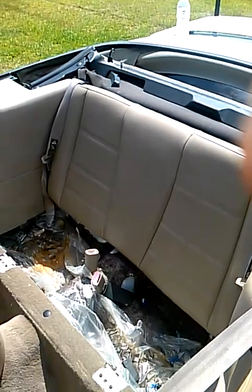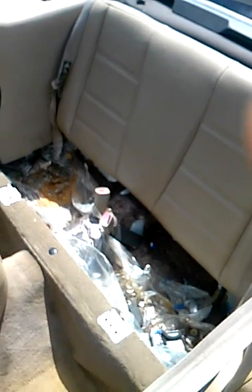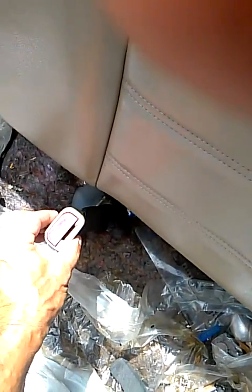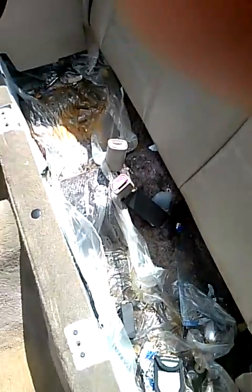Here we go. First, as you can tell I've already taken out and removed the back seat. It's very simply done — there's one clip here and another clip on the right side. The seat was down here; all I did was take the end of the seat belt harness and depressed right here on this clip. Once you depress this clip it pops right up. I took both those clips, depressed them, pulled the seat up, pushed through the seat belt handles, and the seat comes right out.